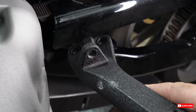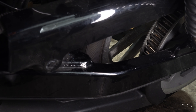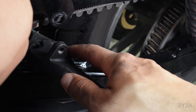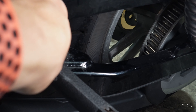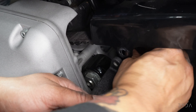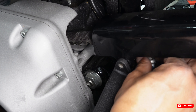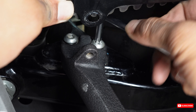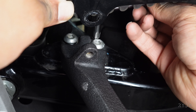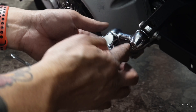As you can see right here, the left side actually has a place — right here — that's going to replace this mount, and that's how you can tell the difference between the two sides. The camera is probably going to be in my way; there's not a lot of room to work over here. But this is how you line it up — right there — and then you just get a screw in there. You want to make sure you can just hand-screw it in — that's how you know you're not cross-threading. Somewhere online I saw that you have to take the whole wheel off to do this, but I'm showing y'all a workaround. It might be harder this way, but it's less time than having to remove your whole rear wheel.